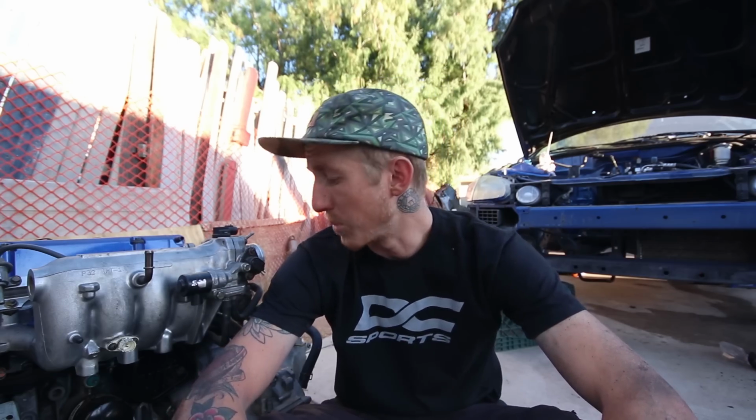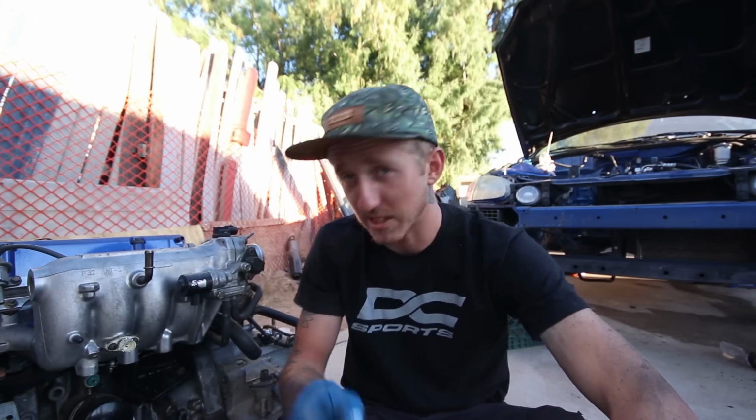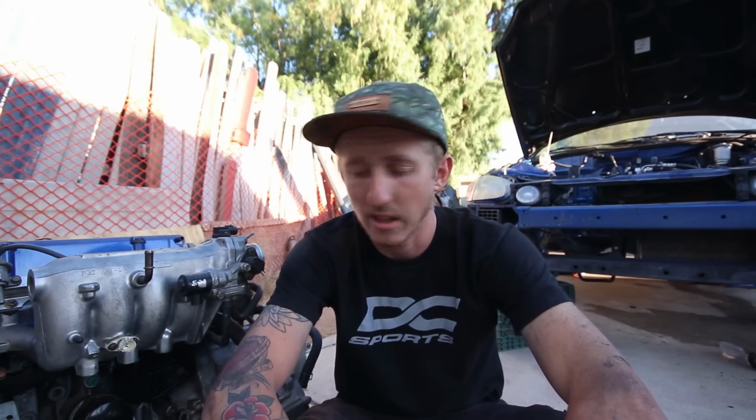I have to go pick up my tie rod boots here in a minute and see if O'Reilly's has those that they can get a hold of me. They're going to be special orders, so hopefully they can have them by maybe tomorrow or Monday. But right now I'm taking the transmission off because I need the hardware off of it to mate the B series tranny to the B20 VTEC.